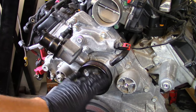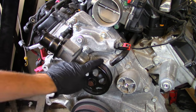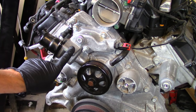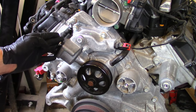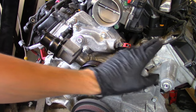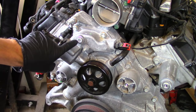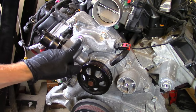Looking at the front of this 5.7 liter, this whole entire assembly right here is the water pump. Got your pulley here. It comes with the thermostat housing lower portion, and it's got the bolt-on radiator hose upper portion from the thermostat. Somewhere usually on the front water pump cover or timing cover, you're going to find this bleed port right here. All it is is a recessed Allen.